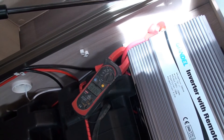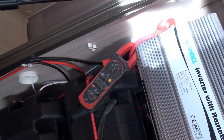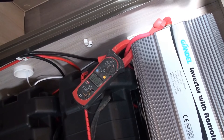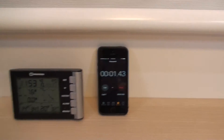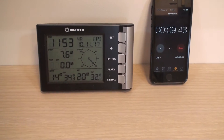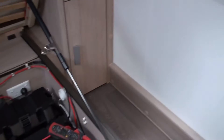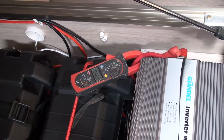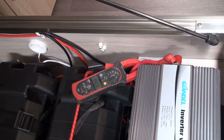I also have my car connected which has got two batteries in it, about 150 amp hours between the starting battery and the second battery, and I've locked them so they're fixed on. I'm running my car just for probably the first 10 minutes. I want to see how long this goes for. Outside the van it's 34.3 degrees, inside it's 32 degrees, so it's pretty warm — good time to test. I've got a 250 watt solar panel — that's what I've upgraded with the second battery. There's also a 250 watt sandwich board solar panel and a 150 watt one on the roof. It's starting to ramp up now — 30 amps. I'm still not sure if the compressor has kicked in, because last time it topped out at about 50 or something like that.